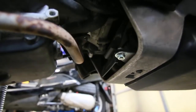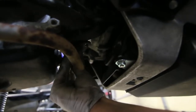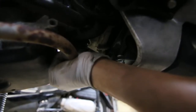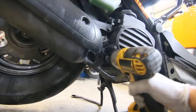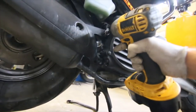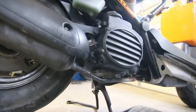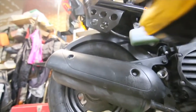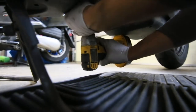We're going to have to put the hand brake on again, and I have the bolts right here — they're 10 millimeters, and you don't even need to remove them all the way. Push the header up with your hand. I took two bolts from the exhaust — the longer one goes on top, the shorter one at the bottom. I started threading them. This is a 12 millimeter. Then switching to my 10 millimeter to get the fender bolt.